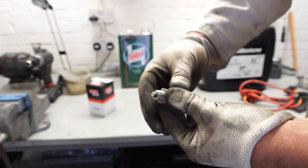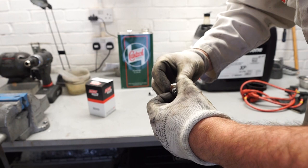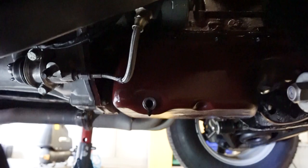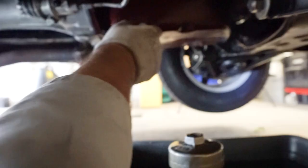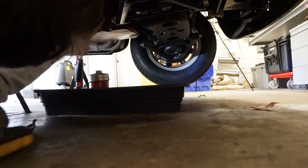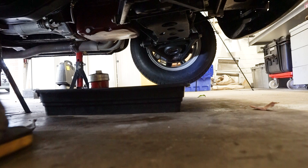So that's the oil filter out — we'll just leave the oil draining for a couple more minutes. Before I refit the sump plug I'll take the old crush washer off and fit a brand new one. These are very cheap so it's worth swapping them each time. The oil is just about finished draining, so I'm going to fit the plug back in and use the socket to tighten it up. You don't have to do it super tight — just a good pinch. You feel that washer just crush up on the last little pull.